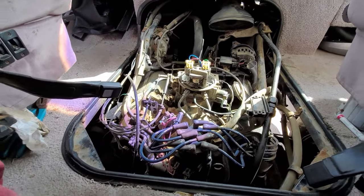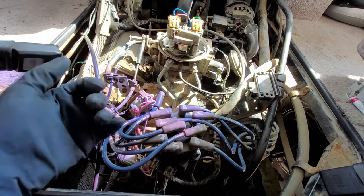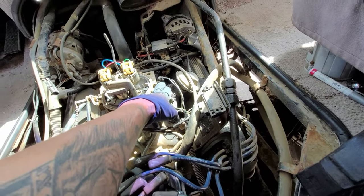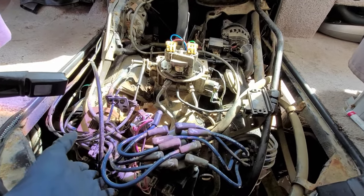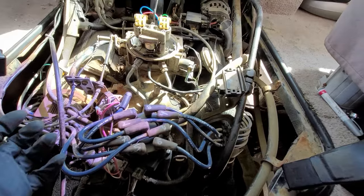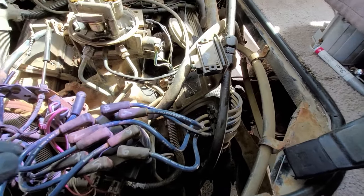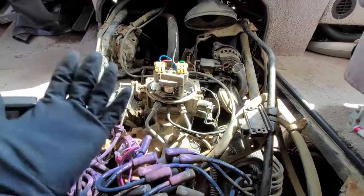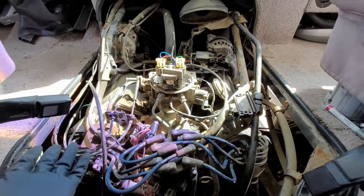I'm checking everything, touching wires, making sure I didn't miss something — and everything's fine. If your throttle position sensor reads wide open throttle, it'll flood the engine and prevent starting. Same thing for the MAP sensor. Then I shocked myself spinning the distributor — I had left the ground cable there. I put the cable down next to the hook, started spinning the distributor by hand, and the thing started injecting. I don't know what happened — it probably sent a voltage spike throughout the system — but it's working now.